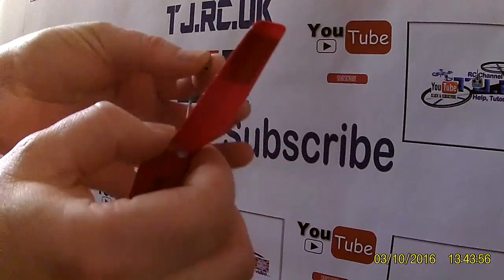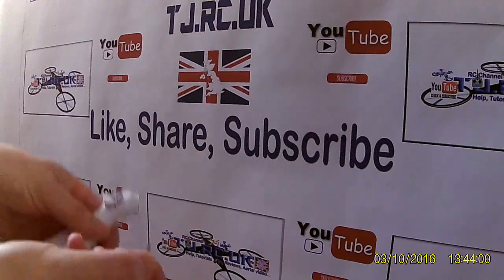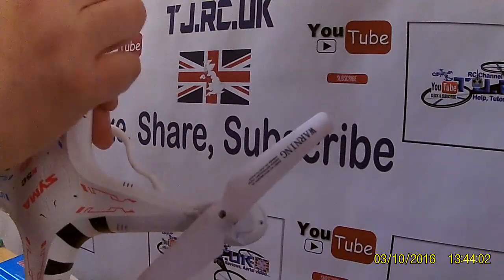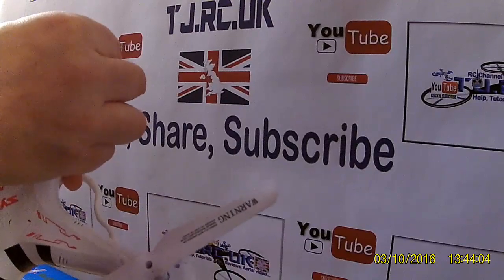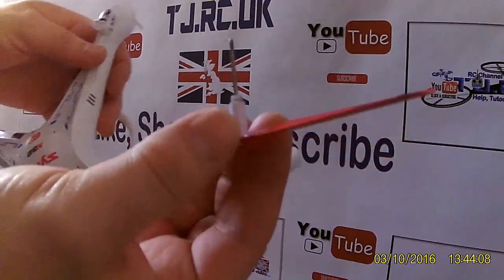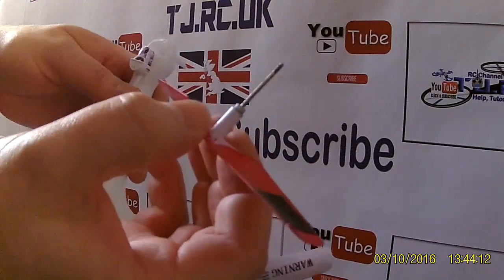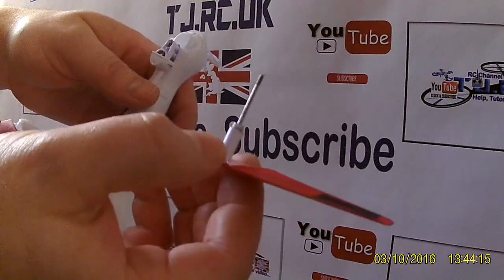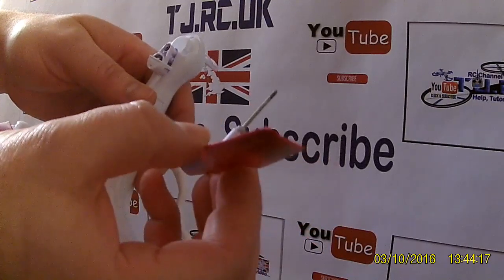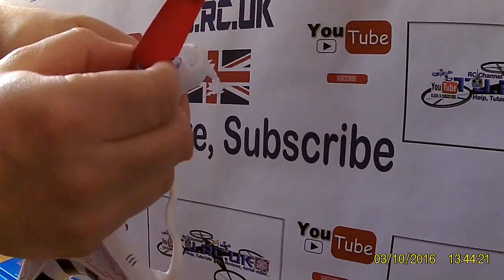It spins on that sleeve. It does come out — put it back in. Once you've got that out you can apply some lithium grease. I use some Traxxas grease on mine, or whatever you've got that you can use on this. Make sure that metal sleeve is in there.